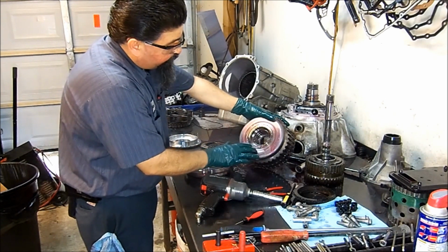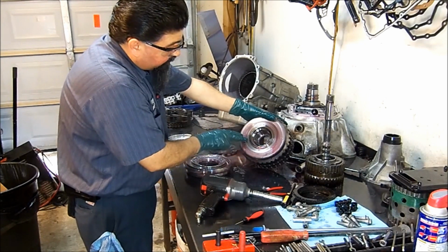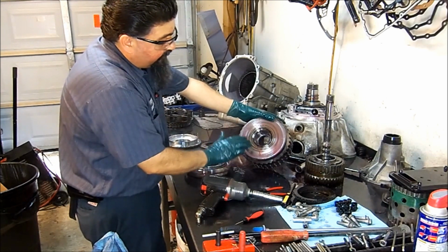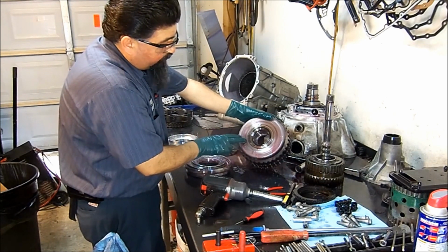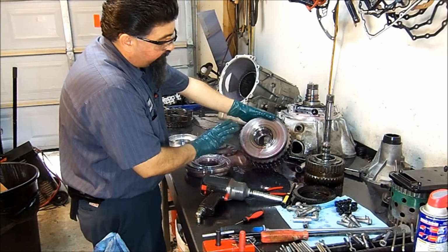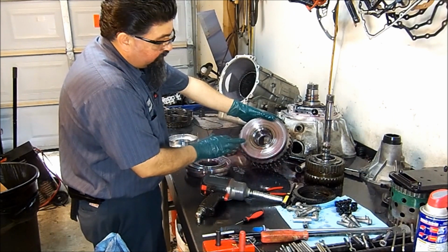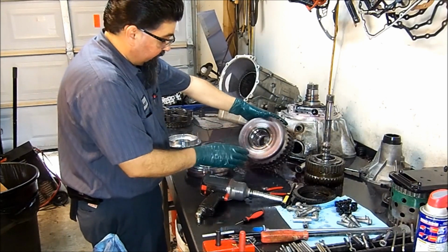they probably welded too hot, and you can see this weld part all the way blue, and this orifice will be discolored. It's going to look like the weld burned a hole through it, but it's not. This orifice is perfectly normal. It belongs there.